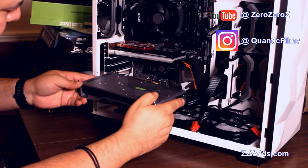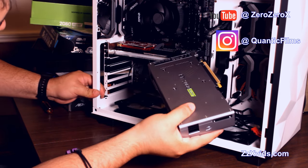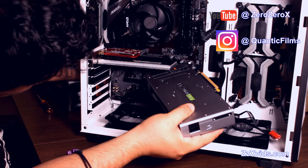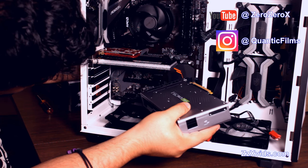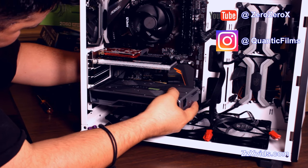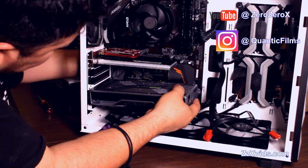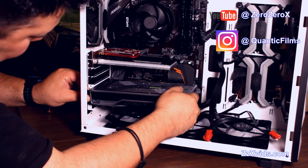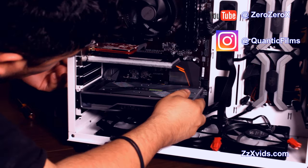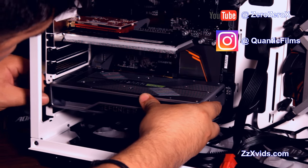And then we're gonna connect it here on almost the last PCIe slot. There's like one more under. It uses two of the slots, but it has the full PCIe connection. That's why I'm using this spot for the dedicated graphics card, and it's out of the way of the NVMe drive, the SSD, the M.2 drive that, remember, it had the heatsink with it.